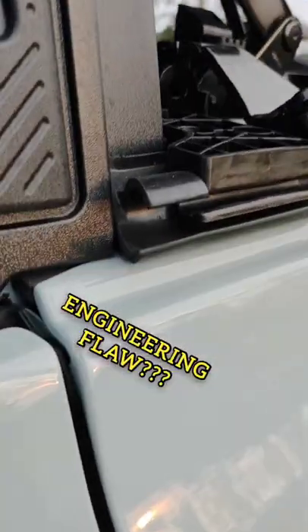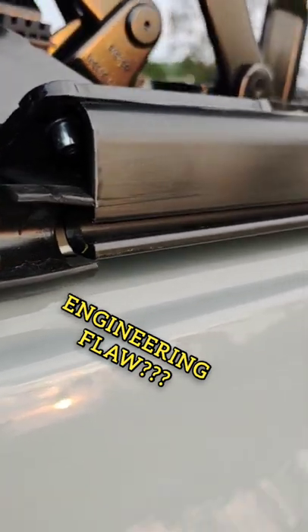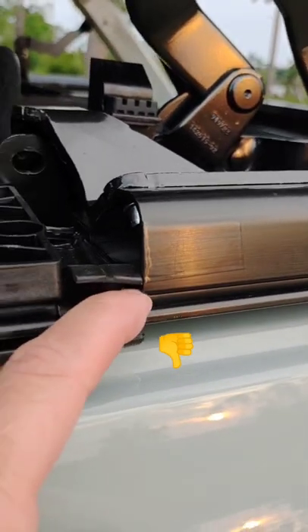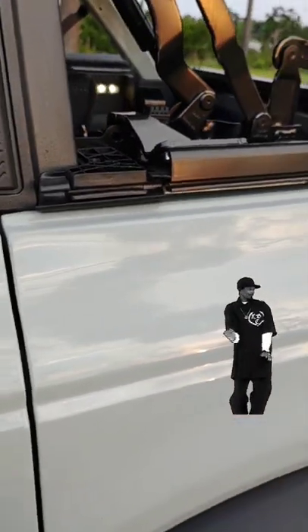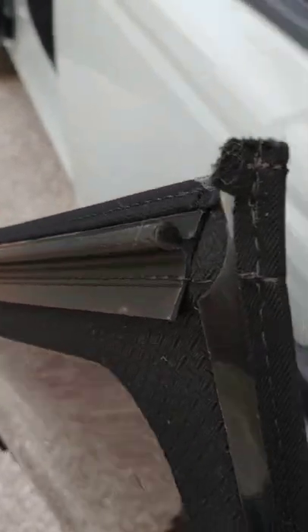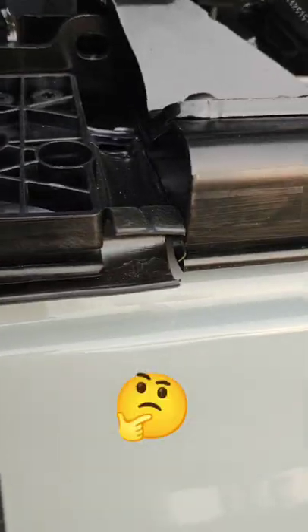One of the complaints I have when the top is on is you've got this little track that the window track fits into, but it gets stuck right here. So what I'm gonna do is trim my window piece from being a flat edge to a rounded or pointed one, so that way it'll feed through the hole better. I believe it's gonna help me put the top on faster and easier. What I'm talking about are these tracks — pretty much a flat surface — and you take that and slide it into the first track, into the second track, and that's where these tend to get stuck, at least on my Bronco.